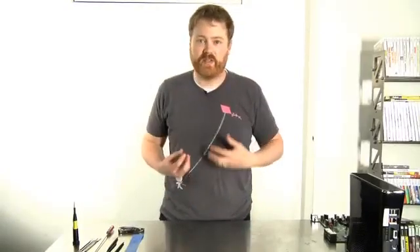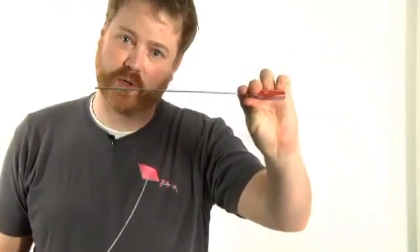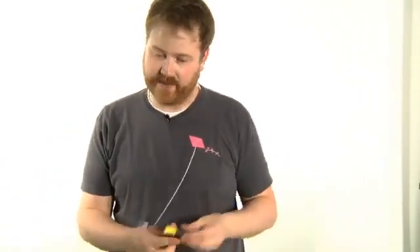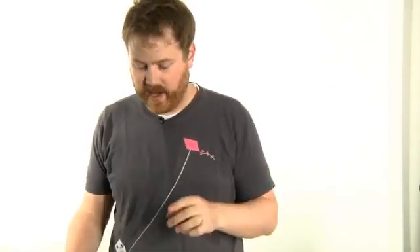I've not taken apart one of the new 360S before, but I have read Nantech's awesome breakdown he posted last week, as well as taking apart original Xboxes of a couple of different varieties. So I have a variety of tools here — a super long flathead screwdriver, spudgers used to take apart iPhones and Kindles, my trusty Leatherman in case I need a pair of pliers, the multi-tip screwdriver with a bunch of different Torx heads, and the classic strip of blue tape for sticking the screws to so I don't lose them and keep them in the right order.